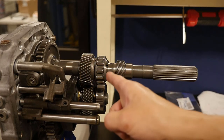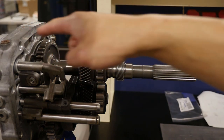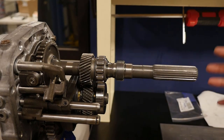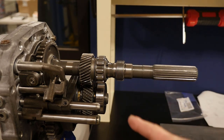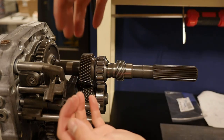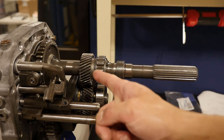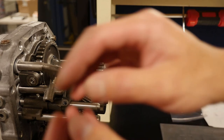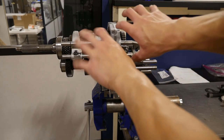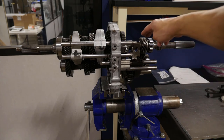Here's fifth gear and the output rear bearing. You have to take these two off in order to take the shafts out of the center plate, so this is not going to get chucked up in a press - no way. You have to find some tool to grab these two and pull them off; they are pressed on with a tremendous amount of force. Back in the day before I knew I was going to build a lot of these, I had a gigantic three-jaw puller to pull these guys off, and even then it was really dangerous and difficult. On a spare W58 I have in my home garage, that's exactly what happened - the shop didn't have the proper tool. It seems like they just opened the cases, looked inside, said it's okay, and glued it back together once they found out they didn't have the tool to press these two guys off.